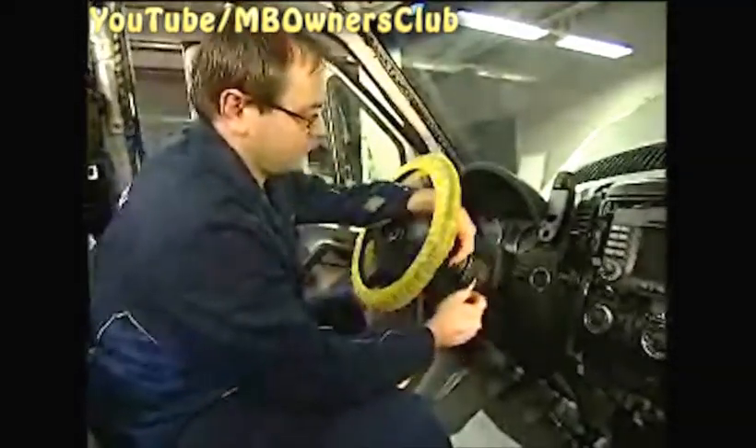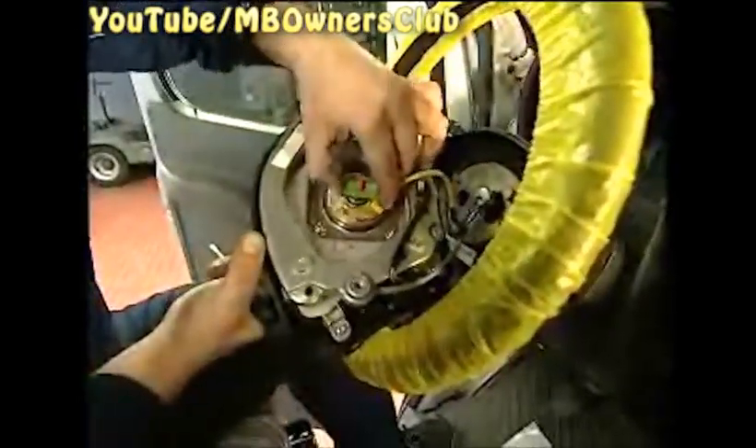Before you remove the steering wheel, make sure that the wheels are straight. First remove the air bag: undo the screws on the left and right of the steering wheel. For installation, tighten both screws with 6 Nm. Take out the air bag and separate the ignition capsule plug connector, and also the cable for the horn and the steering wheel keys. Remove the air bag. With the flex head wrench, unscrew the steering spindle screw. For installation, use a new screw and tighten with 80 Nm. Take the steering wheel from the steering column, leading the cables carefully through the opening.